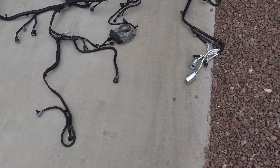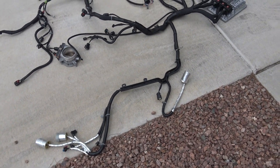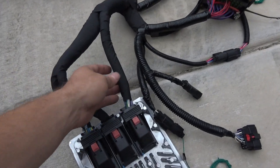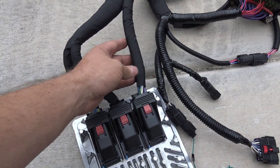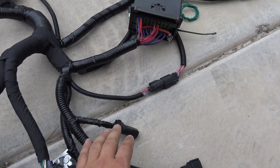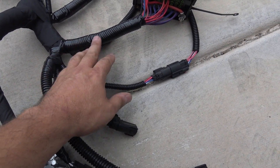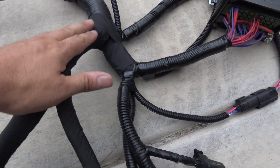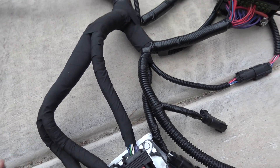So it's really not that much worse than a Gen 4 — there are just a few extra connections. The harnesses are very well made, and there's actually fiberglass sheathing inside to help with heat and abrasion. Then they wrap it with really nice harness tape. I use plastic loom in certain places to resist chafing and a high-quality tape, and I also have harness tape because I actually have to de-loom all this to add certain connections to make everything work for the Jeeps.